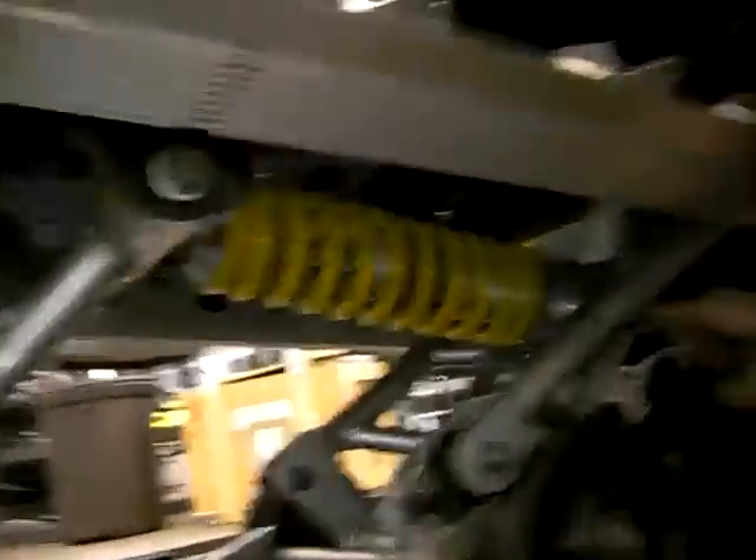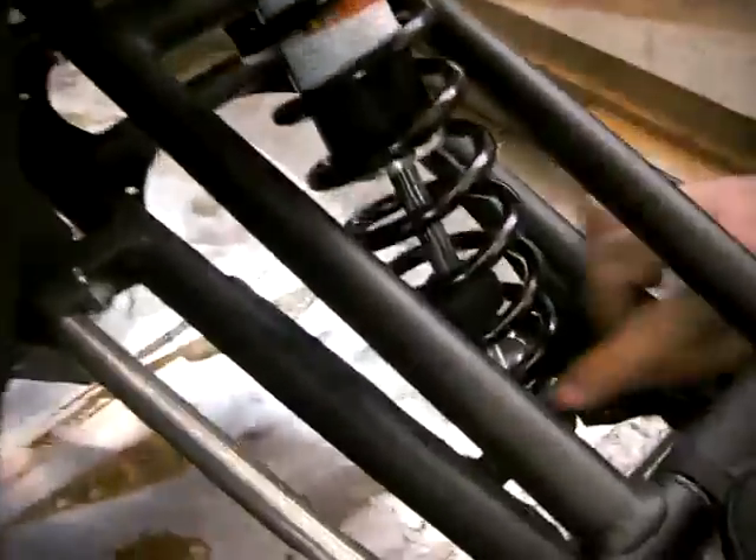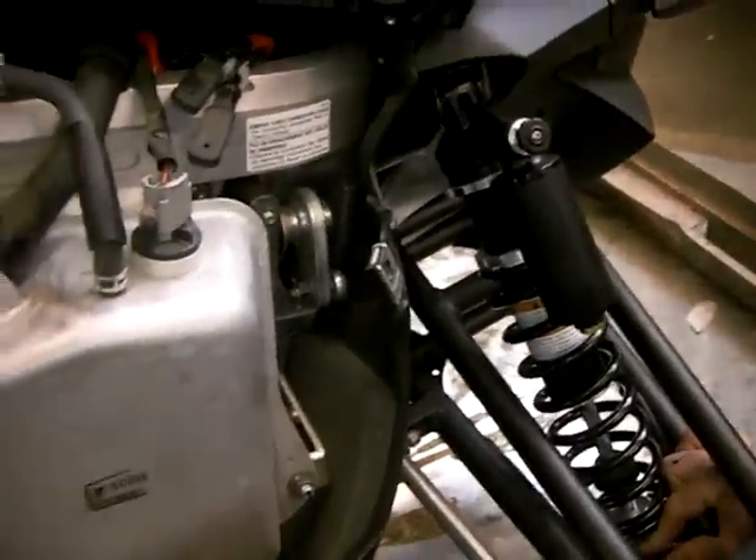Suspension adjustments are on the bottom side of the track. This is your main suspension shock here. There's a preload adjustment on this collar, and on this end there's a rebound adjuster with about 30 clicks of adjustment. On the front side of your shocks, you'll have a compression adjustment, and there'll be a rebound adjuster on the bottom. In your owner's manual, I'll include a card that'll give you some guidelines for setting this up.